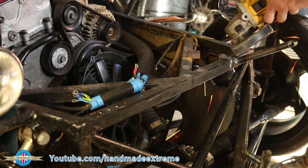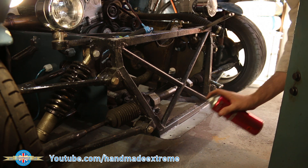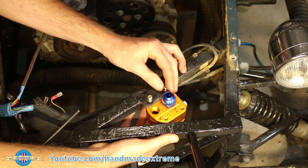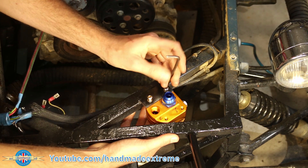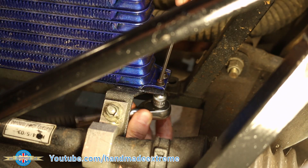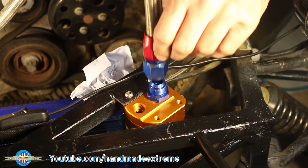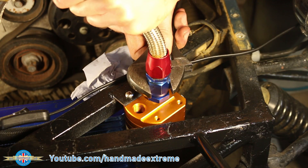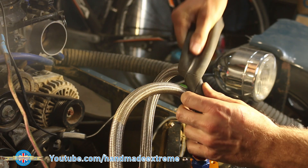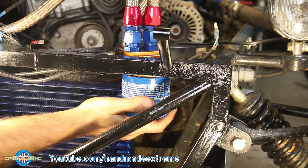While the front end of the car was in bits I thought I'd take the opportunity to clean up a few areas. A little bit of self-etching primer creates a really strong bond with any bare steel, followed by some black top coat — unfortunately the nozzle on this spray can had seen better days. I put the oil system back together next, before putting the radiator in, as it gives me a bit more space to work. The oil cooler goes back on its original brackets, but now it's going to be behind the radiator rather than in front, so hopefully I won't be over-cooling the oil anywhere near as badly as before. I've decided to stick with the braided hoses for now. To prevent the hoses from rubbing on each other or on any chassis or bodywork, I wrapped high-risk areas in some rubber. We'd better remember the oil filter — that's fairly important.